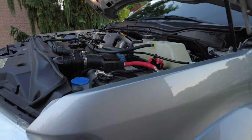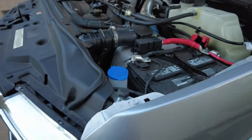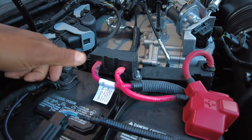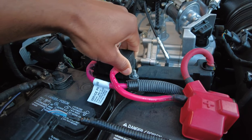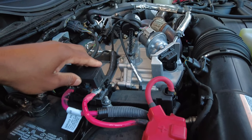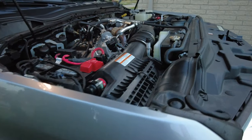What we have is a 400 amp circuit breaker right here. I went with this brand — it's the Mega fuse block, the same thing that we have on our snow plow, which is really nice. You can see it right here. If you open it up, there you can see our 200 amp mega fuse that is for the snow plow. For the 3000 watt inverter they're saying you need a 400 amp fuse.